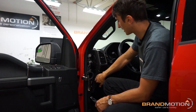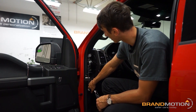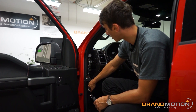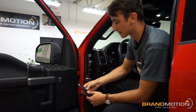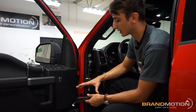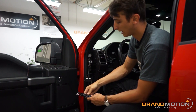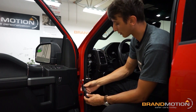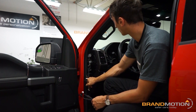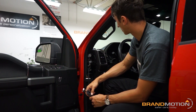So we're on the side of the dash on the F-150. As you can see, I got my hub in place. I've also got all my vehicle connection harness running into the dash for all my turn signal connections. I've also gone ahead and connected my power harness. What's going to happen here is it's going to plug in at the hub and then you're going to use all this extra harness to go up the A-pillar, across the top of the windshield where your ADAS is going to be mounted later on in the install. So now I think we're ready to get the ADAS mounted on the windshield.